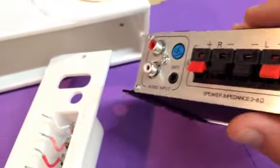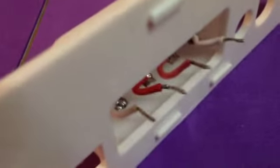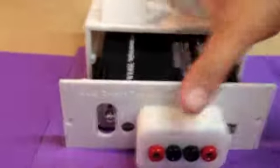And so reversing the process, this is a little bit more challenging part, where you need to reconnect these wires back into the new amplifier back. You can see these 4 different spots go back into the back of our amplifier here. So I'm going to go ahead and do this because I need 2 hands. I won't be able to show you with just one hand how to connect it, but it's going to be a process of one hand using these needle nose pliers, and the other reaching under there and depressing that tab so that I can open up that space and get the spring and that clip to grip on the wire. And you just want to make sure that the silver is pushed right in. It just has to make a good connection, you know, so if you're 3/4 of the way in or mostly in. Alright, so here I am. I've got this all connected up, and I'm going to push this back into the amplifier assembly. So I'll just push it right in.